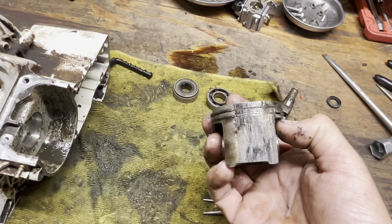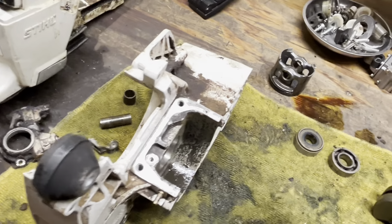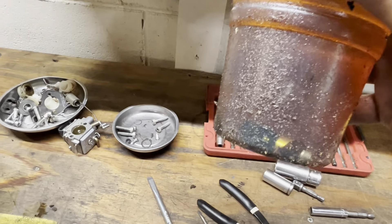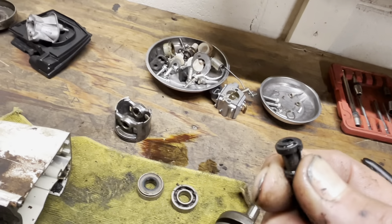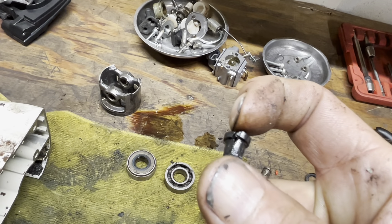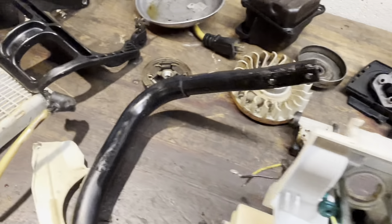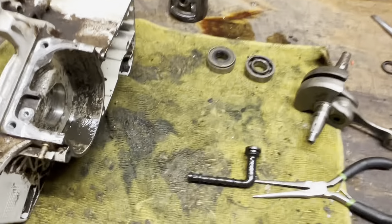She's cooked pretty good, guys — you never know what you're going to get into with these. Here's the oil line: when I drained the oil out of the case, the oil screen that should have been attached to the end of this was unhooked. And look, that's cracked. I don't know if somebody was trying to reach in there and yank on it to take it out, or maybe it wasn't oiling. So I'm going to take a look at the oil pump just to make sure it's doing its thing.